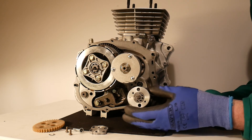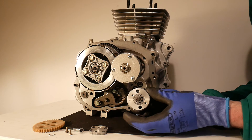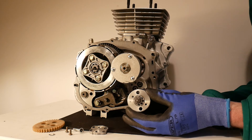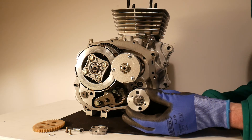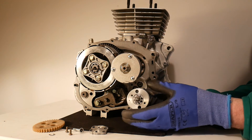The input port is on this side. Just watch one of the teeth moving around — take this one at the very bottom and watch it moving around. It's opening up a space between the inner and the outer rotor gear teeth. As it moves, that space is getting greater, and that actually sucks in oil — that cavity sucks in oil. As it keeps rotating, the oil is trapped between the teeth and it actually closes up. So at this point it is closed up fully, and this is where the output port is. The oil has nowhere to go but to be forced out through the output port.